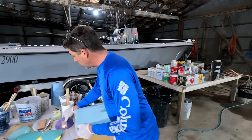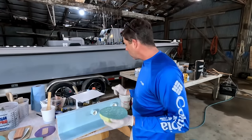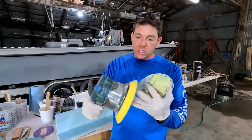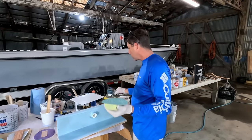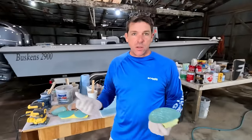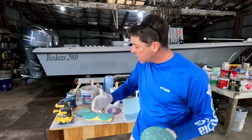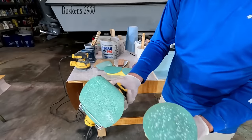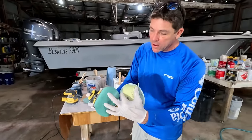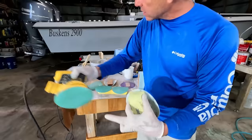While the material is getting there, let me talk about sanding options. One standard for automotive work is a Hutchins DA — dual action pneumatic sander — air powered, so you need a compressor. There's also a DeWalt electric orbital sander. You can get standard round discs and they're interchangeable, with a little dust bag. This one orbits and also oscillates — it goes round and round as well as back and forth.